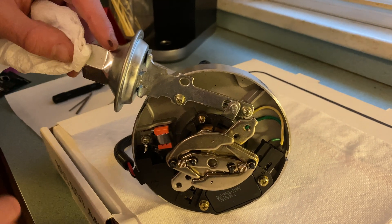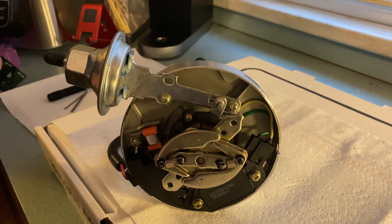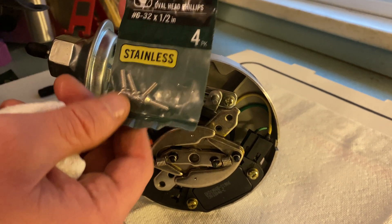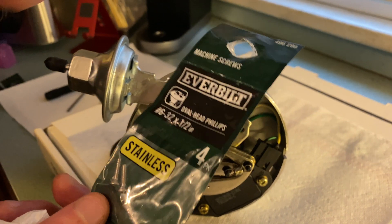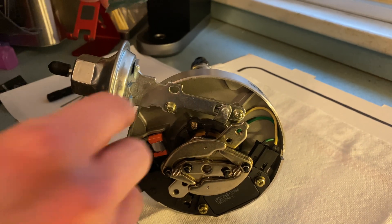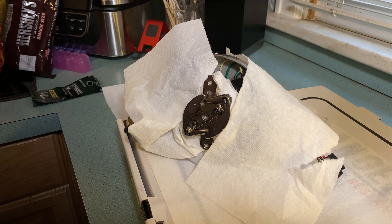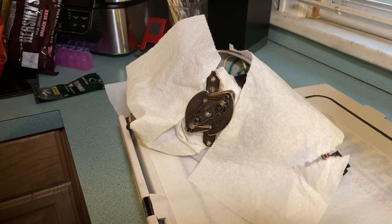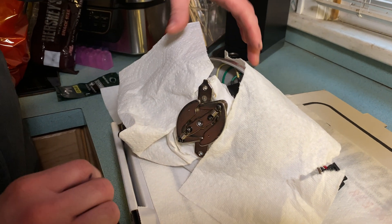Do you use a sheet metal screw? I have these little number six machine screws — they say should thread into a hole drilled by a one-eighth inch drill bit almost perfectly, so you don't need to tap it. You can just thread it in and it should fit pretty good. One thing you want to do is put paper towels around the distributor so that metal shavings don't get inside.